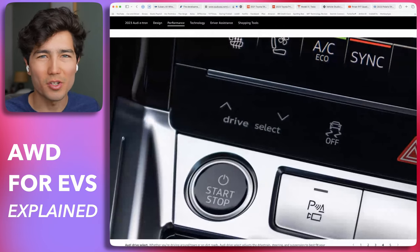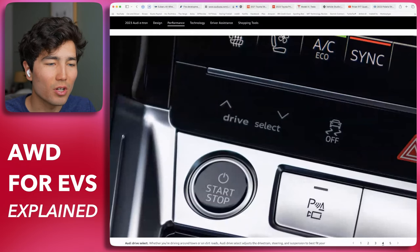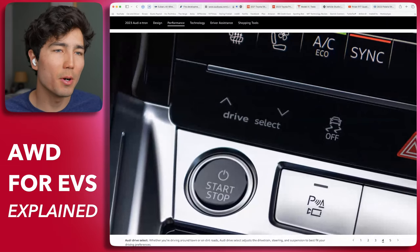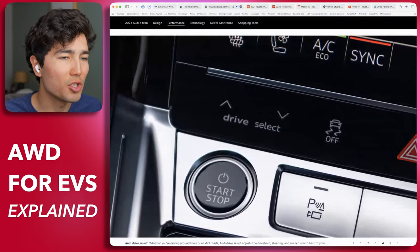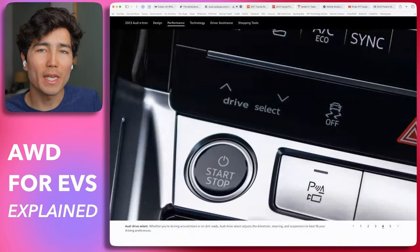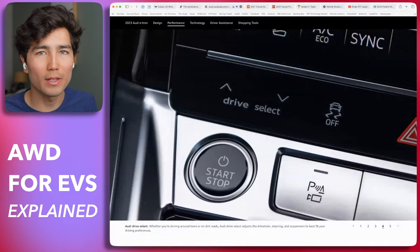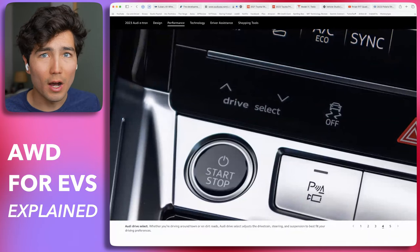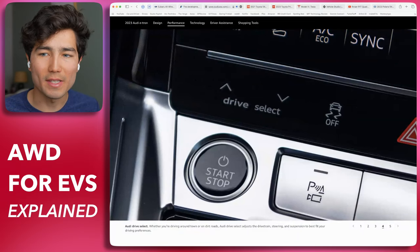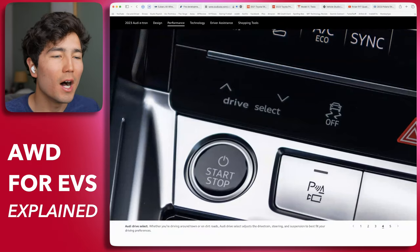Usually you can enable all-wheel drive on or off via drive modes, because most electric cars can disconnect or turn off one of the axles depending on their motor type. In the Audi e-tron, changing your drive mode changes the AWD functionality. Instead of moving mechanical components like a gas car would, it simply turns motors on or off or engages them more or less using electronics — which tend to be quicker, since motors can respond much faster than an engine. An engine can only adjust its power a few times per second, while a motor can do it thousands of times per second.